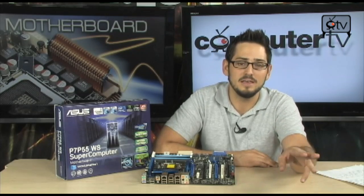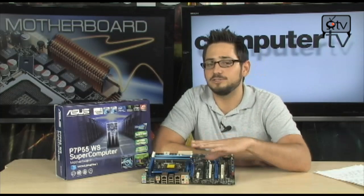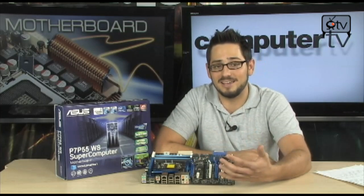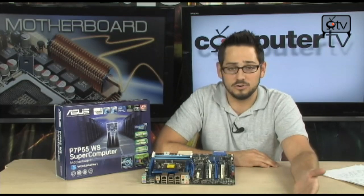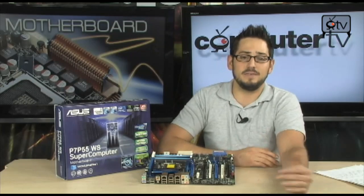Especially with two-way SLI it works really well. With three-way SLI, that third card won't make full use of its power to the processor — same with three-way Crossfire. So it still works; you can still use it for gaming and overclocking. But again, the board is designed specifically for workstations using CUDA-based Tesla cards like the C1060, some Quadro cards, or for people that need to drive a lot of very large monitors.